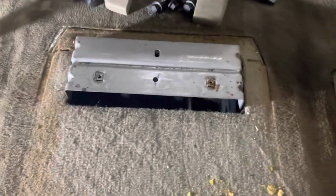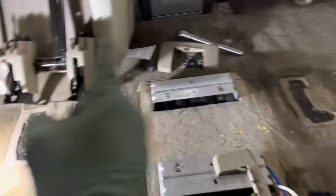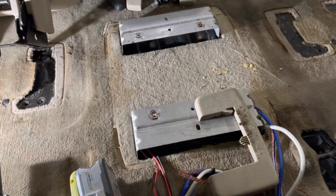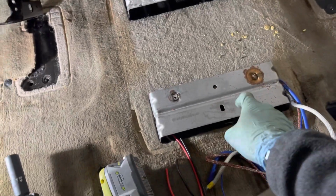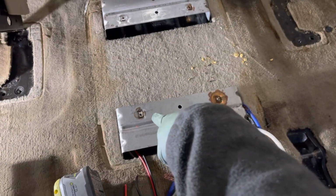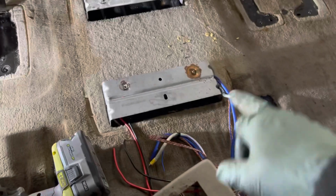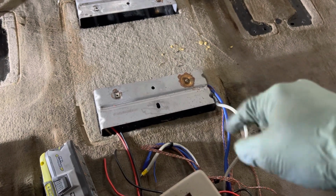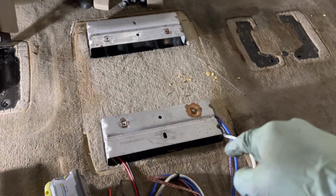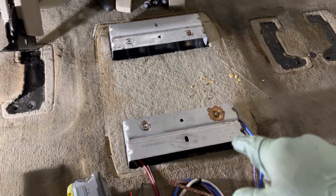And then for people who are wondering about swapping this middle console for a 20% middle seat, it's supposed to be 40, 20, 40. Some Navigators came with that option of having this sort of bench seating. Supposedly, there's the screws here. It's all made for it. You're going to have to cut your carpet, and you're going to have this big gaping hole where the console was. But there's a 7th hole. Supposedly, there's a hole covered with a grommet that you need to tap out for the 7th bolt. But I guess I'll do that once I can source a middle leather seat to put in here.